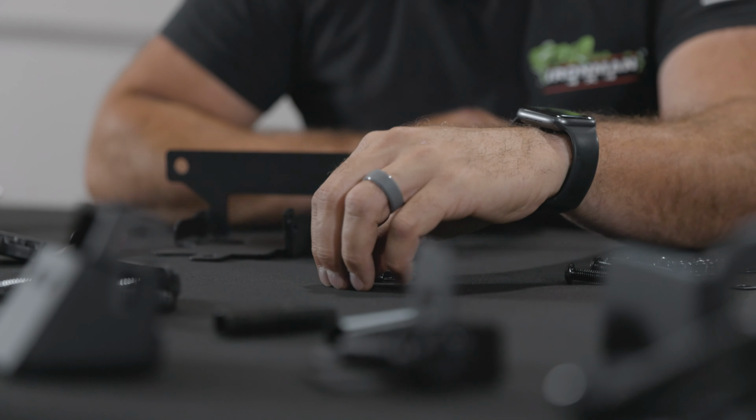All right, let's get our camera relocated into our front bracket here. So we're gonna grab this bracket, grab your camera, that fits in just like that. And we're gonna take this little backer plate, and that is gonna drop right behind the camera, and it kind of keeps everything locked into place. Then we're gonna grab an M6 button head. We'll push that through. We'll put a M6 washer on it and a nylock nut. So I'll get that on finger tight. I'll do the same thing on the other side.